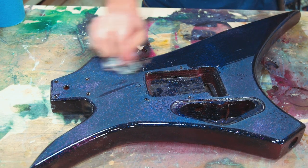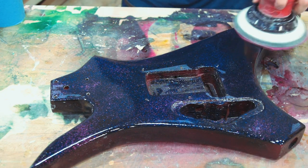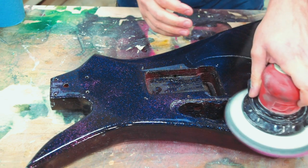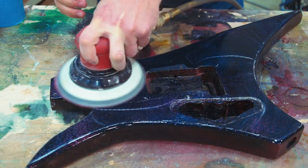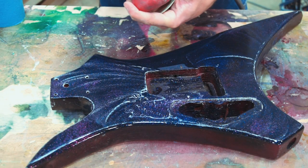After a thousand grit, the finish is going to look hazy, and that's kind of part of the process. We work our way up and then we remove that haze by going to ever finer grits. In this case, we're working with the 2000 grit right now. And then when we use the compound and subsequently the polish, those are essentially just like really, really high grits — they are abrasives and they're going to get this incredibly smooth so that we get a nice gloss at the end.